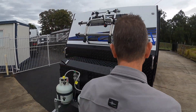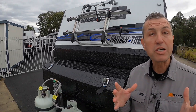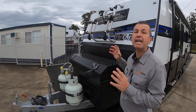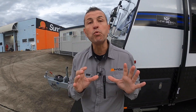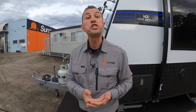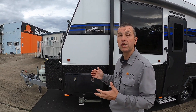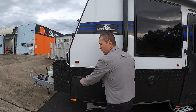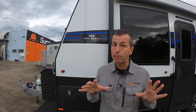The Jenner family have decided to add not one but two bike racks — one at the front of the van and another on the back. Now let's talk about the chassis: this is a Roadrunner Australian-made chassis. They only use Australian steel and have been providing chassis to the RV market here in Australia since 2006. The chassis is three mil thick, and the Jenner family have upgraded to three-and-a-half tonne axles, giving them a greater payload — which they'll need as a family of five.